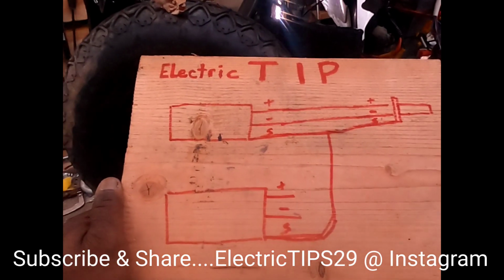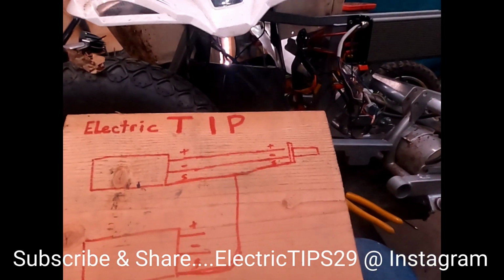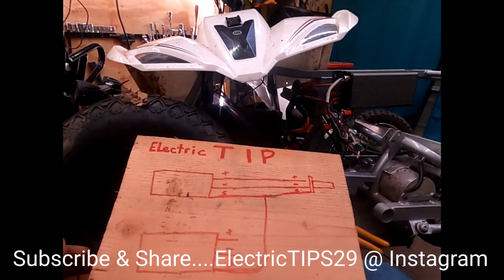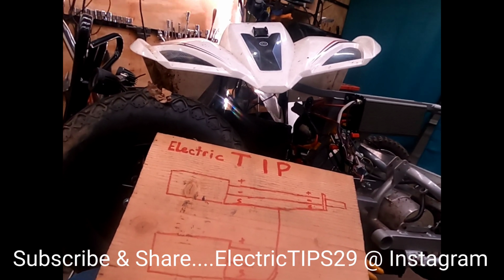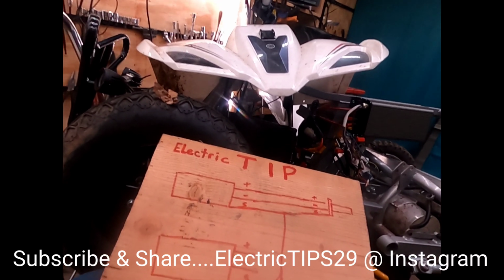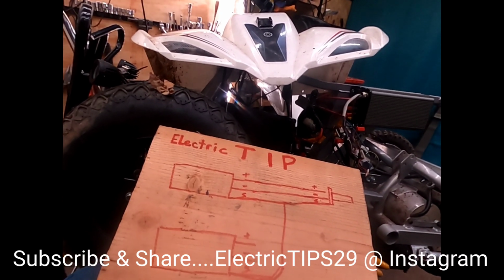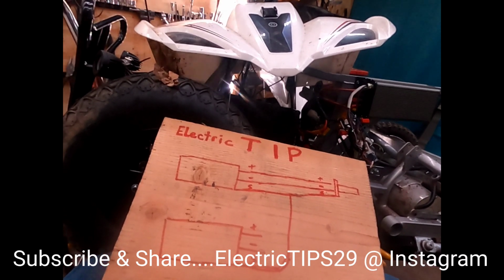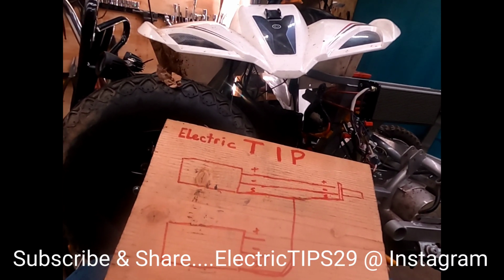Now, reasons you might do this. Once again, I only built 2 vehicles with torque transfer, and that's this quad sitting right here, which is very fun, and a go-kart that was torque transfer. But sometimes when you build a bike and you've got one rim that's more powerful than the other, people never hit the other throttle. They just hit the powerful one. With one throttle they use the power equally and don't heat one motor up as much, because the motors can take the load off each other and act as a turbo, which allows them to not heat up as fast.